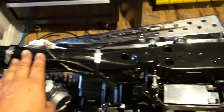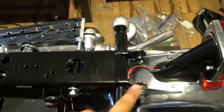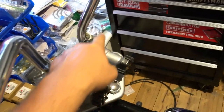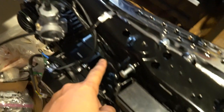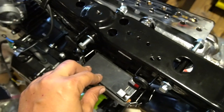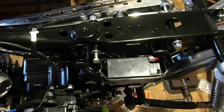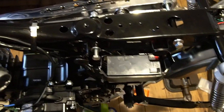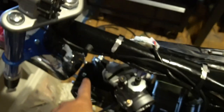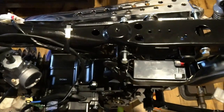If the cables aren't long enough I'll do some extension leads. Test fit of the K2 harness looks good — there's enough lead to get to the back tail light and wires out the front headlight. I mounted my starter button down on the lower part and there's plenty of lead to get all the way back to my battery tray and starter solenoid. To clarify, my kill switch is my key switch — the button I mounted is the starter button.